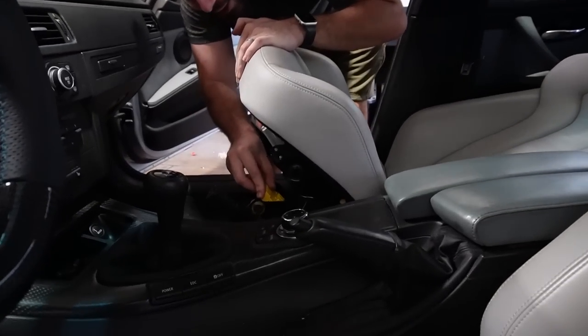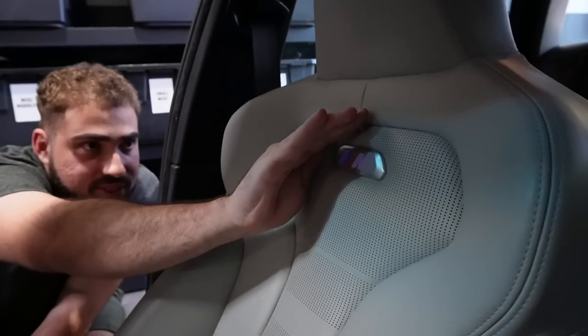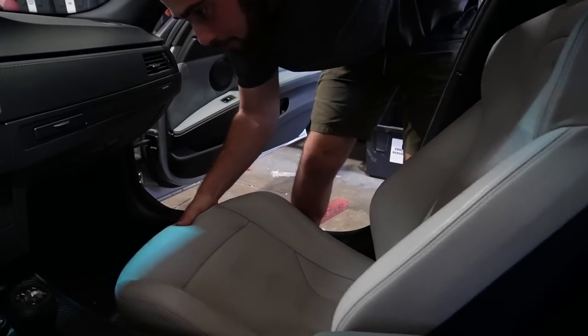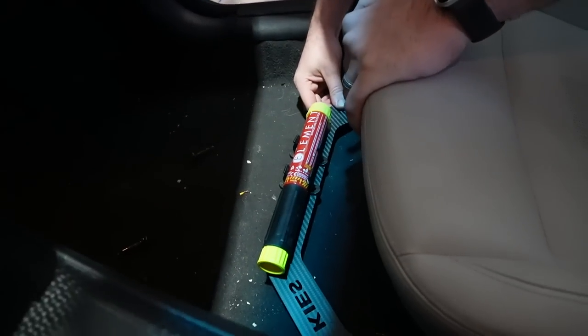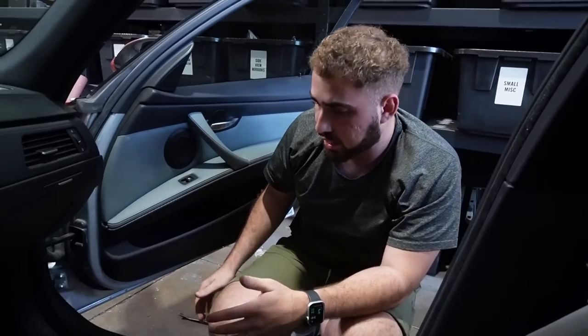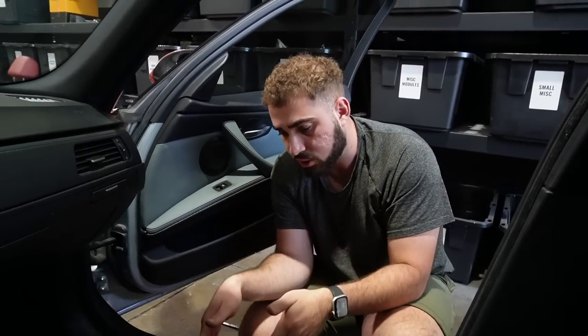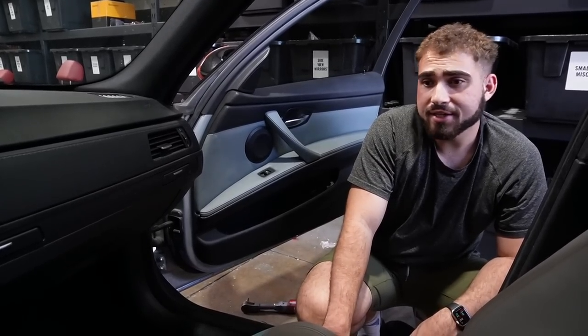Both sides are moving — good sign. Lights are coming on, just like that. Now that we got that dialed in, let's get this Keys Motorsports fire extinguisher reinstalled, because safety first. By the way, that seat position sensor cable — most people doing this swap leave it unplugged, so just be aware there's no automatic stop on the seat travel. Don't over-extend the seat forward or backward when putting in the bolts, or that's how you break things.